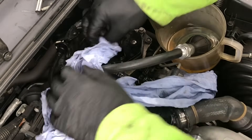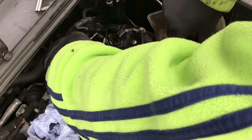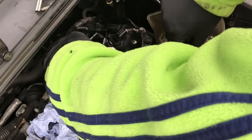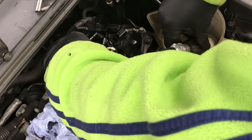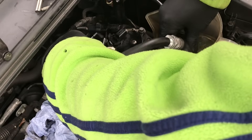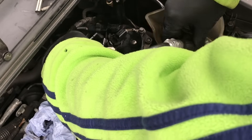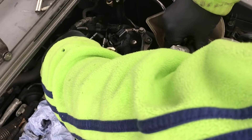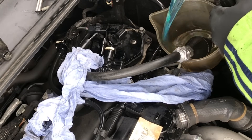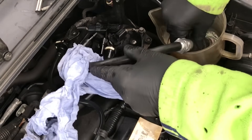If you leave any air in there and try to start the car, it'll just pump air straight into the injection pump and you'll never get it started. Unfortunately these Ford Focuses don't have a pump in the tank, so there's no primer — turning the ignition on won't do anything at all. It's a real downside to this model. You have to do it by hand and fill that filter housing — they don't self-prime at all, so even if you run out of diesel they can be a nightmare to get going.